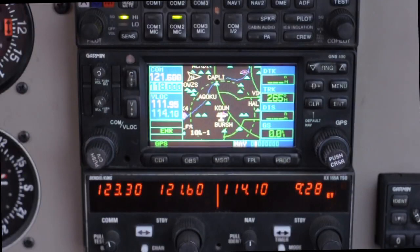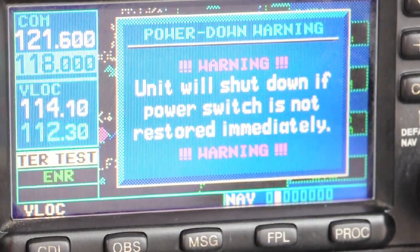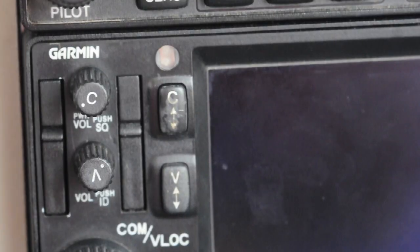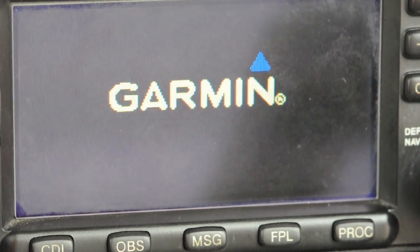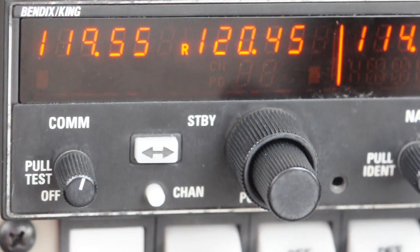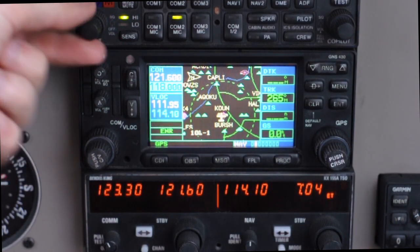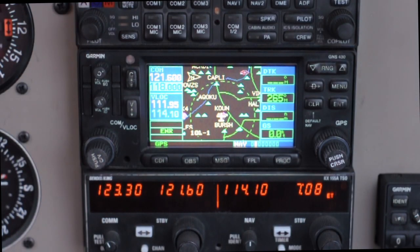If none of that is working, you can actually unplug your headset and plug it into the right side of the panel, then key the right side yoke microphone to see if it works. We can also try resetting the comms by turning them off and back on using their volume knobs — turn the volume knob all the way counterclockwise until it clicks. The Garmin will give a warning then turn off; let it sit for a couple seconds, then turn it back on. COM2 works the same way with its own volume knob. You can also reset the audio selector panel using the intercom volume knob, turning it all the way past its detent. A neat fail-safe feature: any time there's a power interruption or malfunction within the audio panel, it directly connects the left side pilot's headset to COM1 — so before turning the unit back on, try transmitting to see if it works.